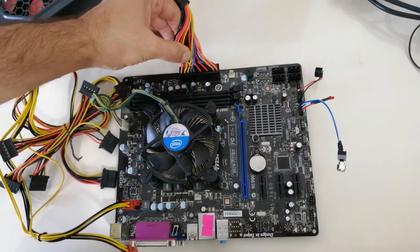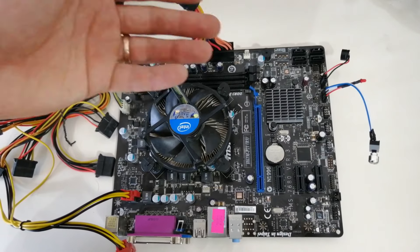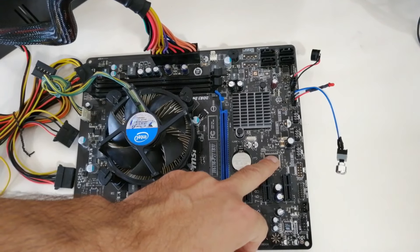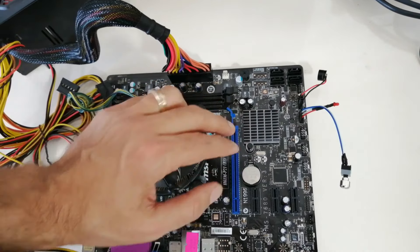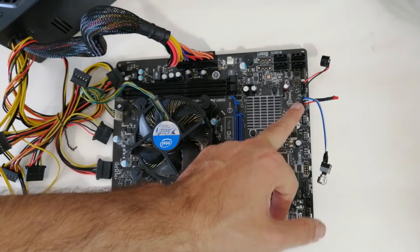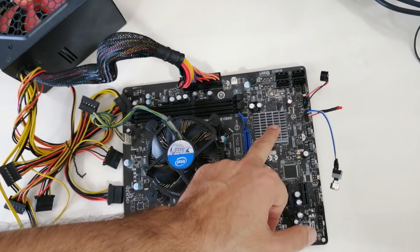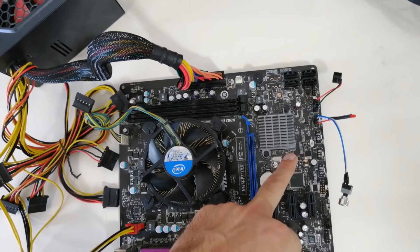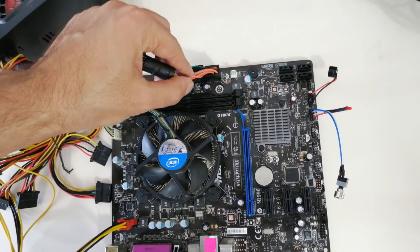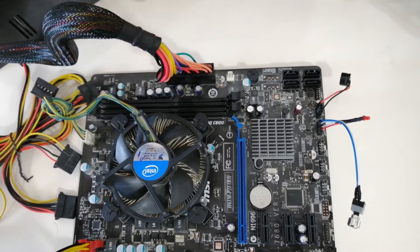By switching on the power supply, plus 5VSB enters the motherboard through the purple wire and after passing a regulator IC, it generates plus 3VSB. Those voltages enter the PCH and IO. First, IO gets reset; when IO is reset, it sends the RSMRST signal to the PCH, which resets the PCH. When I press the power button, IO detects that power is switched on and sends the power button signal to PCH. In response, PCH transfers SLPS4 and SLPS3 signals to IO. When IO receives SLPS3, it decreases the PSON voltage to zero, the green wire drops to zero, and the motherboard turns on.